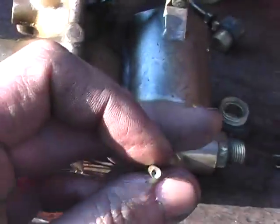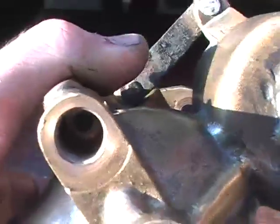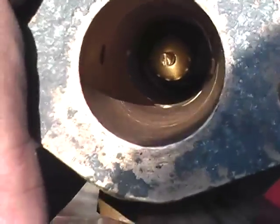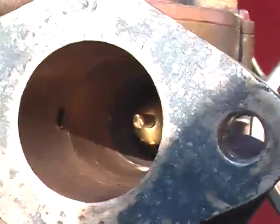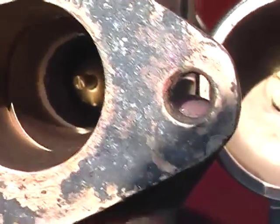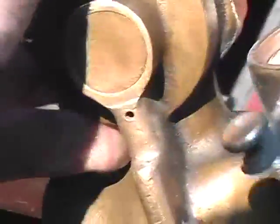Both jets are tubes from top to bottom, really. The bottom is always in petrol, as supplied from the float chamber. So, when the throttle is completely open, there's a small hole in the drum — which you can't really see in this shot — but that swings into line with the power jet channel there.